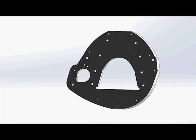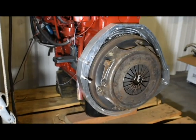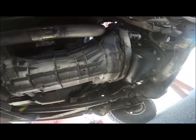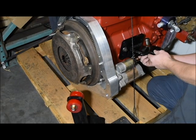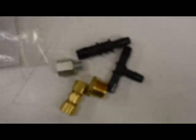Right now, the manual kit does require that you source your own flywheel and a starter from a 6-liter diesel Ford truck. Both kits keep the transmission in the stock location. The kit is also designed to be a completely bolt-in application — even the motor mounts on the frame side of the truck are completely drop-in. It's all the basic parts to get your engine in your truck and get you up and running.